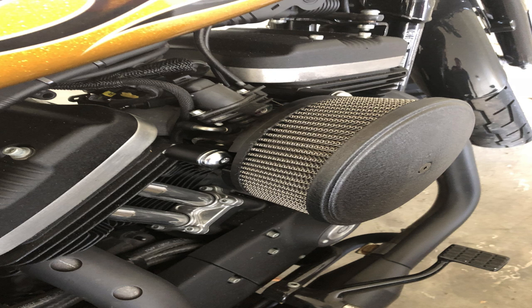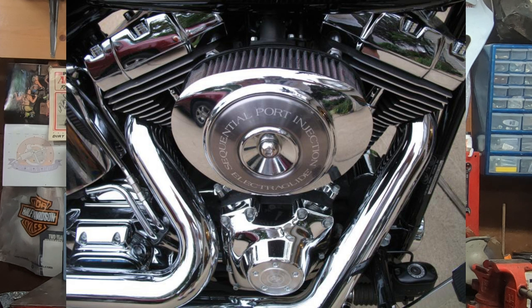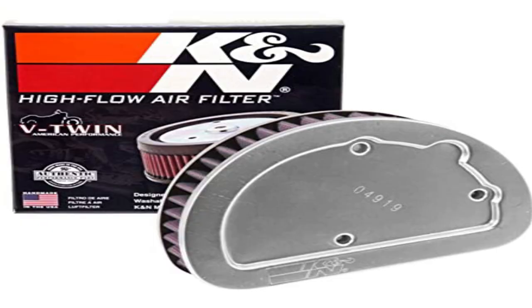One question that always comes up: take Arlen Ness's Big Sucker air cleaners — the Stage 1 and Stage 2. The only difference is that the Stage 2 has a larger filter element. If you're not sure what you're going to do to your bike, go ahead and get the Stage 2, because you cannot over-air the motorcycle. No matter how much air cleaner you have on a stock to mildly modified bike, it's only going to use so much air. If you're interested in air cleaner upgrades, generally the best option is to go with an open element — putting a K&N in a stock air box will theoretically increase flow, but that stock air box is so restrictive the only real benefit is a washable, reusable filter.